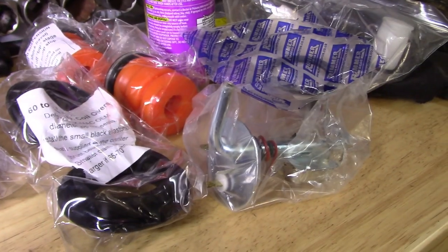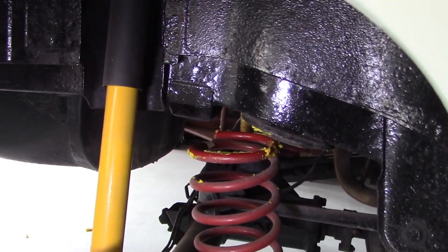The fuel gauge is not working, which I've done before on one of these. I seem to remember having to drop the diff out to get to the fuel tank. In the rear end, the car's been lowered a bit and the springs are shorter, and they've actually come out now that I've jacked the car up because of those little bushes that are gone. So if the diff does have to come out to do the fuel gauge, I'll do it once I get those bushes back.